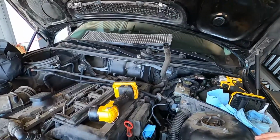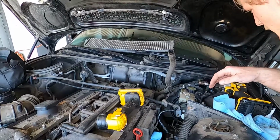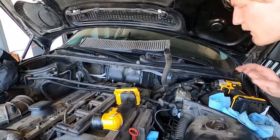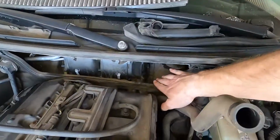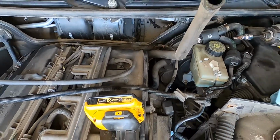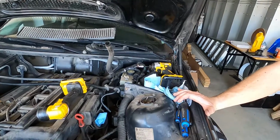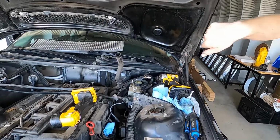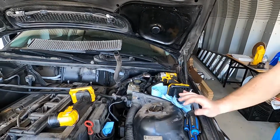I don't know, you'd have to do some research on how that heater core works. I'm guessing that, well, maybe it's ahead of that. Because looking at those aluminum pipes, they go in down underneath the fan box and keep going inside, so the heater core could be even further. It's under the dashboard. You'd have to move underneath it. So it could still be that there's another door down deeper that's not actually directing the air properly anymore.